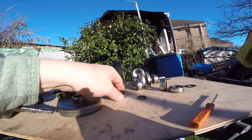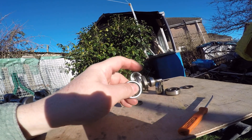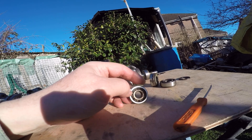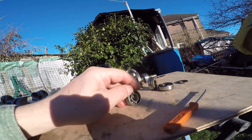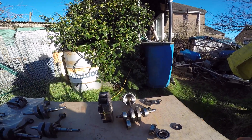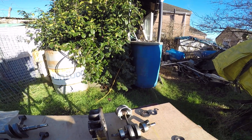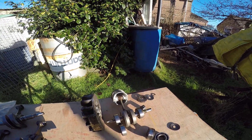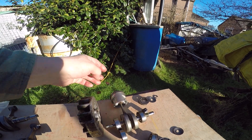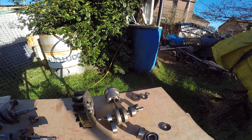So what does this actually mean? This one is out of a Husqvarna, and you can see it's seized — feel how stiff that is to turn. You can see all the grit and dirt on that side; that's the outer face, that's the inner face. Dirt, grit, and material — and also air — make their way in here and into the crankcase. From the crankcase it goes out the transfer ports, through the combustion chamber and out. It can cause damage to the piston, but it certainly causes damage to these main bearings and to the big end bearing.